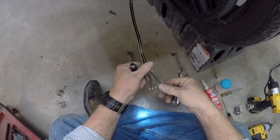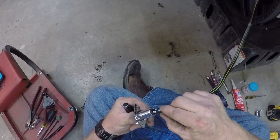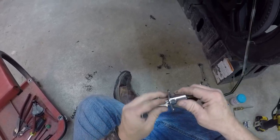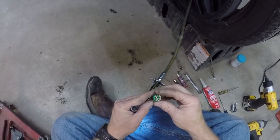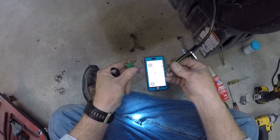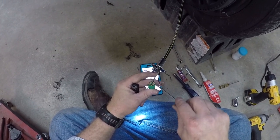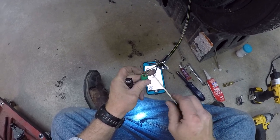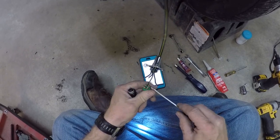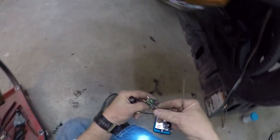Dropped the wire through. I did solder these ends, and I also will seal that up, but I put some dielectric grease in these holes. So, use my cheat sheet here. Because weather, moisture, and corrosion are not your friends. And I'm an electronic technician, so we're going to make sure that I only have to do this once. Okay.